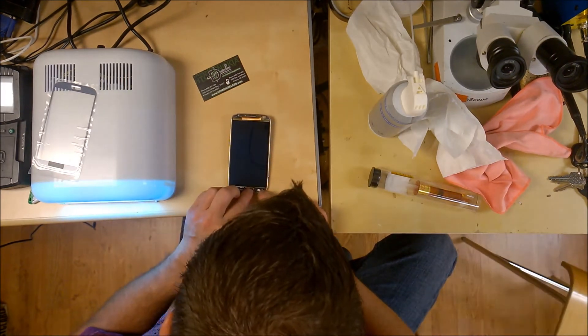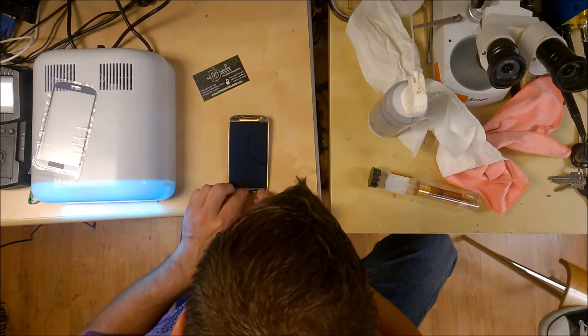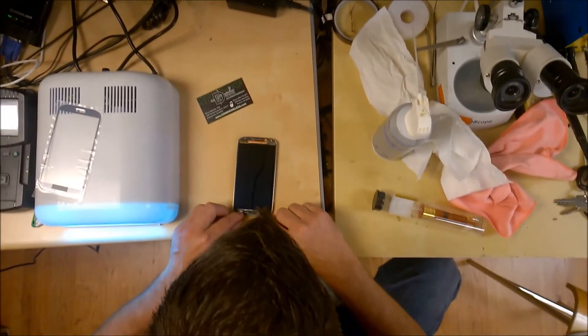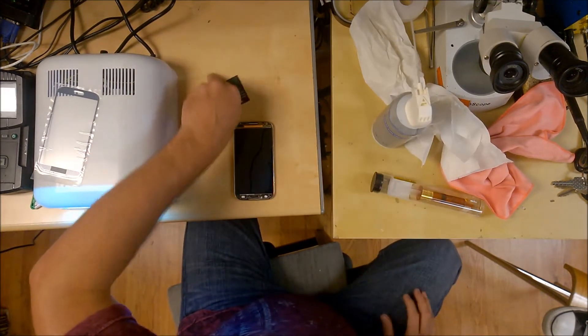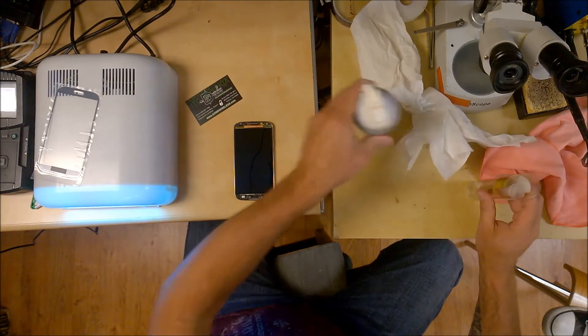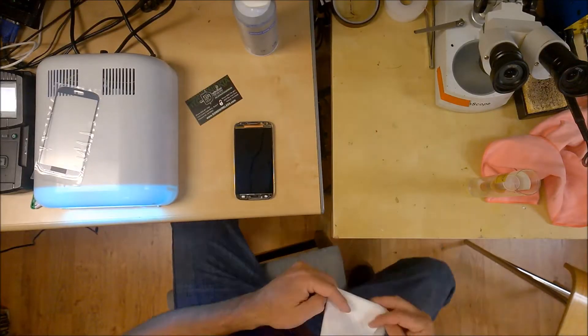You can see him putting the home button on here. Do remember to put the home button on and make sure that the earpiece mesh is installed on the phone, because if you put that glass on with the glue and you cure it, it will not come off. One thing about this is that once you repair them, the glue is much stickier than the manufacturer's glue and this stuff is not made to be removed again. So hopefully you don't break your screen after the repair.